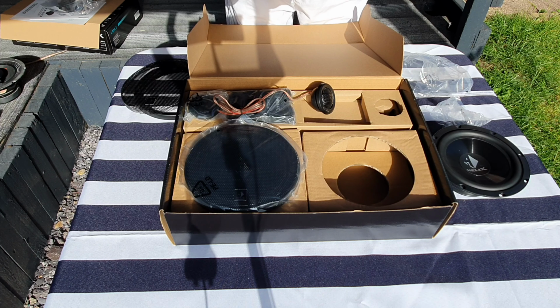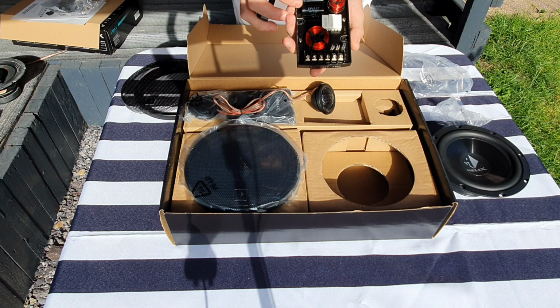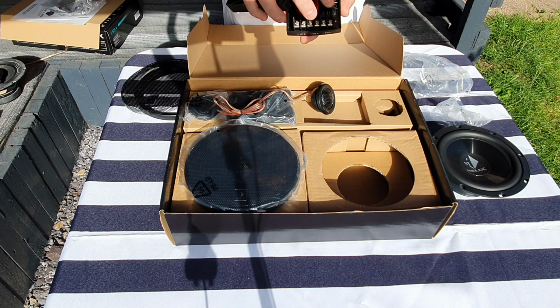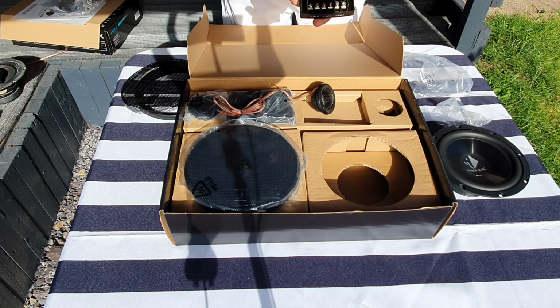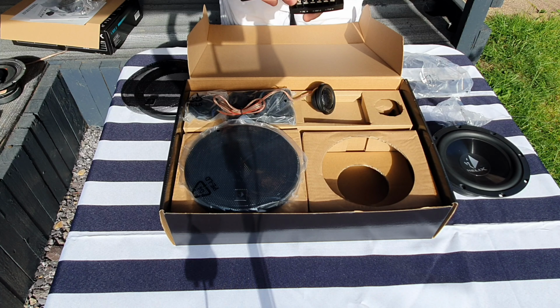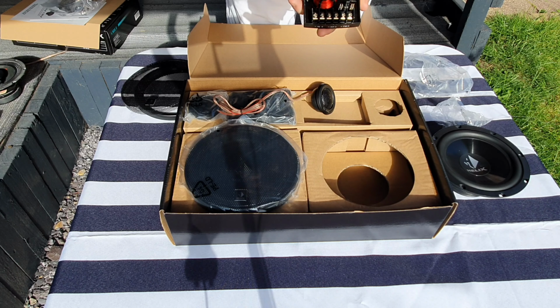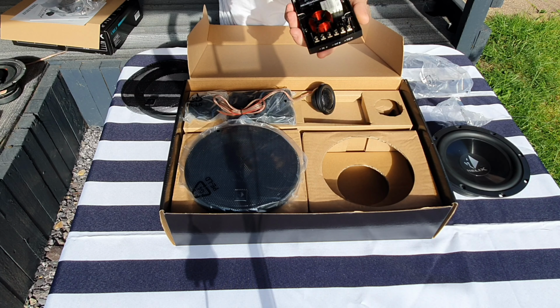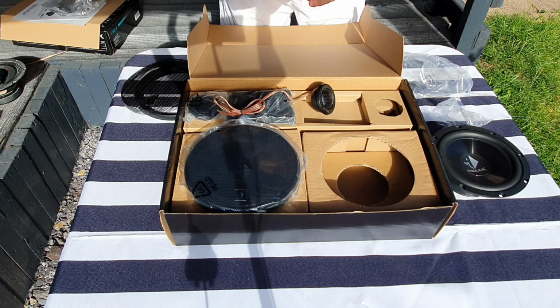It's like the settings on your head unit basically. You'd drop down the bass for instance on your head unit, or drop down various different frequencies, the same thing. So you're taking 2 dB off the output, so it'll basically tone down the tweeter. I'll leave it on 0 for now because I don't know how they're going to sound yet. Obviously you can go +2 as well if you want extra highs. I'm assuming that is for the tweeter side. We shall see when that happens. I'm pretty sure it will be. Yeah, they're pretty nice, to be fair.